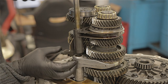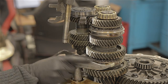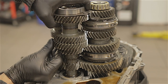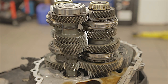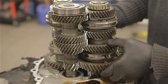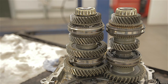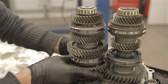I shall remove this gear chain shaft. This is your input shaft - you've actually got to tip the other gears out of the way so you can slide this one out. Easier said than bloody done. Oh, nope - it's come out. There we are, that was easy. I feel I should take the rest of the gear shafts out and just check the bearings in the bottom - I'm sure they're perfectly fine, but it's worth having a check anyway.